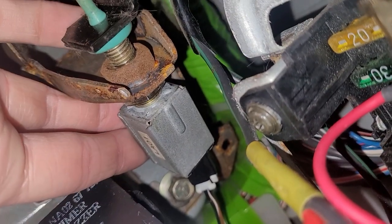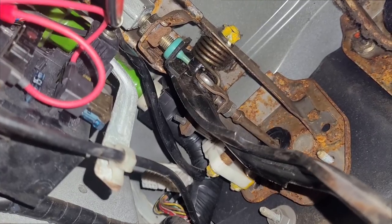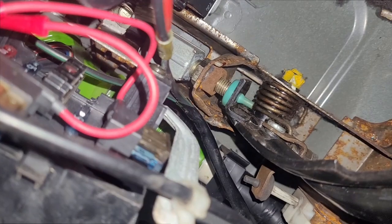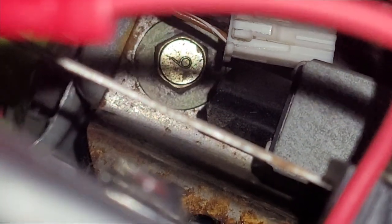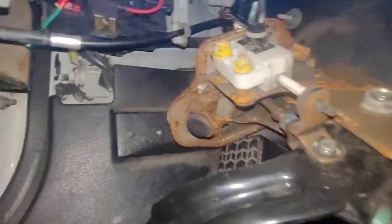Here's one connector. So this is the whatever box — up here you can see where that disconnects. I found that 12 millimeter bolt. There's our pedal — it comes up here. You see that connector thingy that we just unplugged, and there's that bolt. I have a clear line for a socket and an extension. Here's the pedal — we've taken it out, it's come down to the floor. I had to shimmy it just a little. It wasn't that bad.